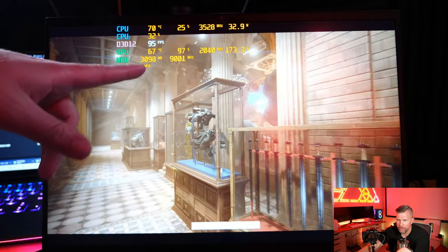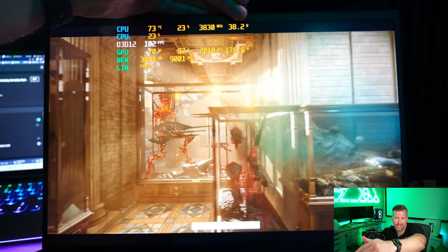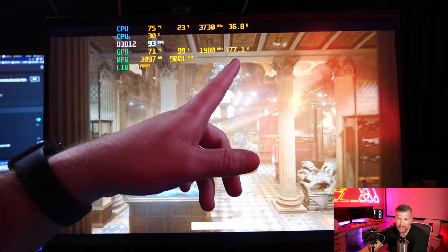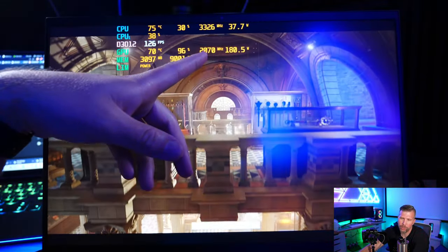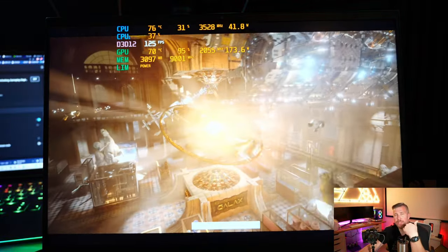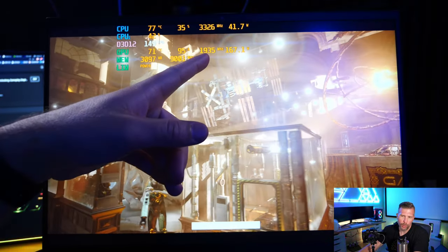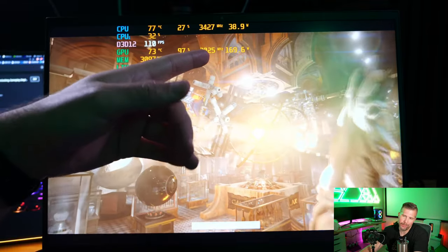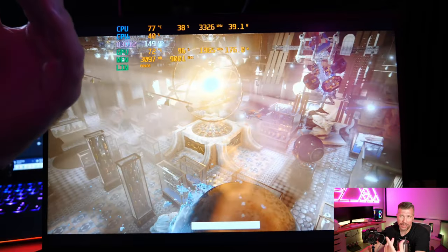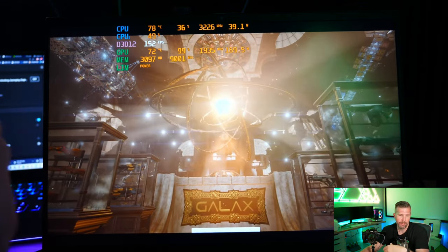All right, so our CPU is only pulling 39 to 40 watts. It's interesting because in the GT77 tests, we're pulling more like 50 to 60 watts in these kinds of tests. Now, our GPU is pulling 178, 180, 190 right now. The wattage there is interesting. 177. Our clock speed, though, is only about 2,000, 2,100. 2025, and with the GT77, the base with no overclock is doing more like 2200 as an average. So in this one, we're doing a little over 2000 as an average, right around 2025, 2050 or something. So our base overclock is not as high as what MSI does on their GPUs. So it's important to notice right out of the gate that the GPU is not as highly tuned from the manufacturer.